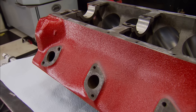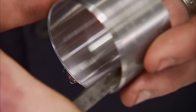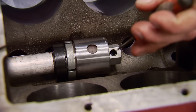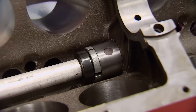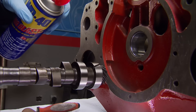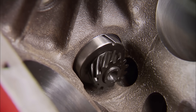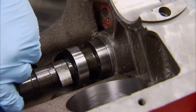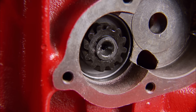With the block dry, the cam bearings are the first new part to be used. We'll use our Goodson Bearing Scraper to deburr the bevel on each side of the bearing — this eliminates the chance of any rough edges being rolled into the bearing as the cam is installed. Making sure the oiling holes are oriented correctly, tap the bearing into place. Now we can spray a light coat of WD-40 on the cam's journals and test fit it. If it turns nice and easy without any tight spots, we know the bearings are in straight and the cam's line bore is still in spec. And it is.